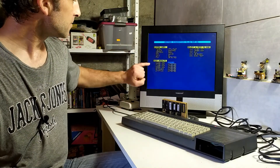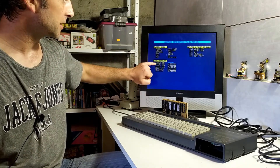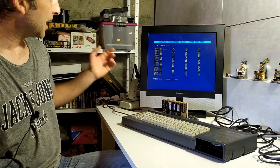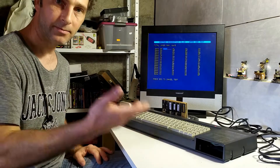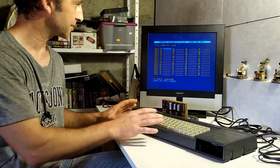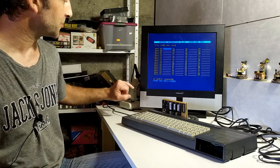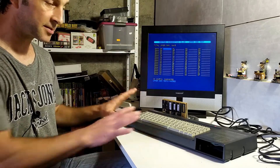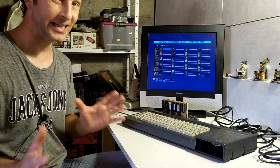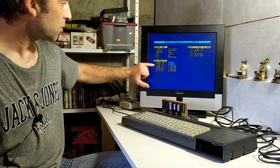The other tests we can run include the upper RAM test. We know we have 128 kilobytes of RAM and the lower 64k is good, so we press U to check the upper 64k. If I had the full four megabytes installed this program can test all of that, though it would take a long time. It comes back confirming the upper RAM tests have passed — so memory should be perfectly good in this system.